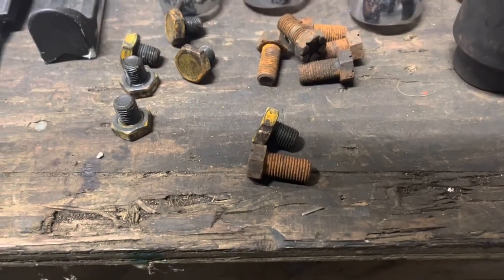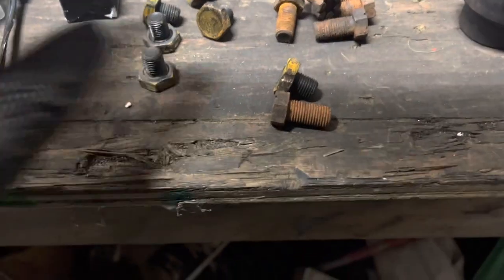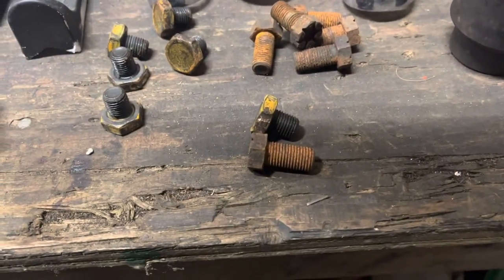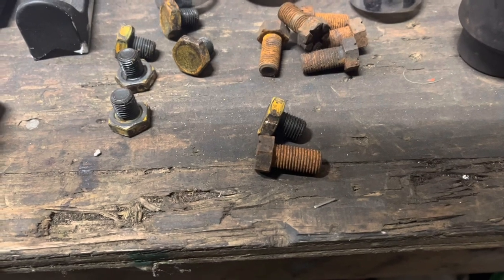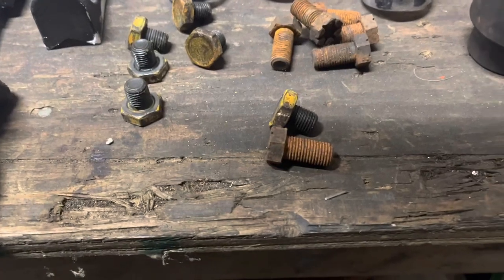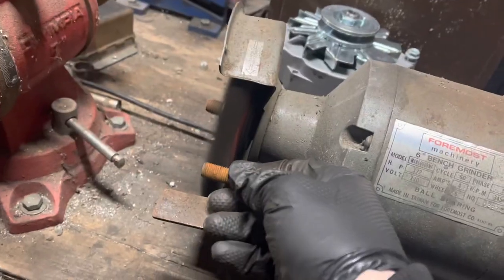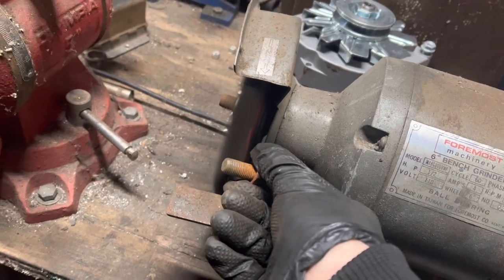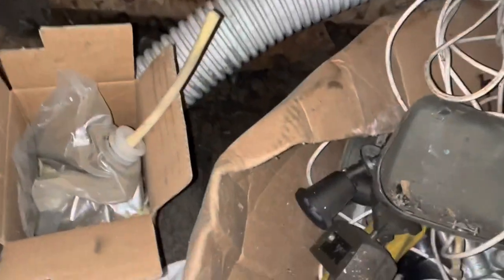Here's why you can't use your factory automatic flex plate bolts — flywheel bolts are much longer. I actually can't remember from the last time I did this. I'll be lucky if they're long enough to fit the sandwich plate as well. Next several minutes of my life looks like this! Hold your bolts carefully, or they disappear into the horrible rat's nest crap hole you haven't cleaned up yet.